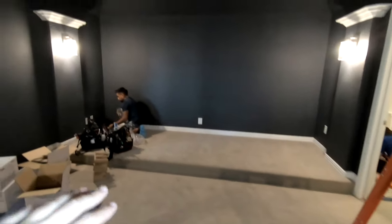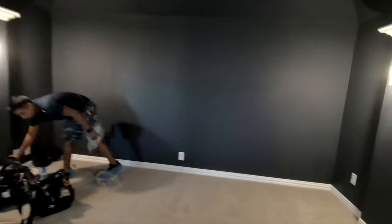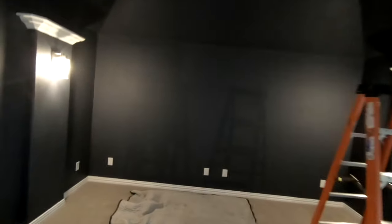So today we're doing a 7.1. As you see here, we have the front of the room — a perfect spot for our 133-inch Dragonfly high contrast screen. It's got a nice wide area and the room itself is large. I think we're at 15 feet to that first step there, which is perfect for our Epson 4050 projector — 4K — that'll be projecting onto our 133 Dragonfly. On either side of that, we have our Klipsch 6000Fs. They're tower speakers and we already have the lines down on the floor, perfect for the floor-standing speakers.